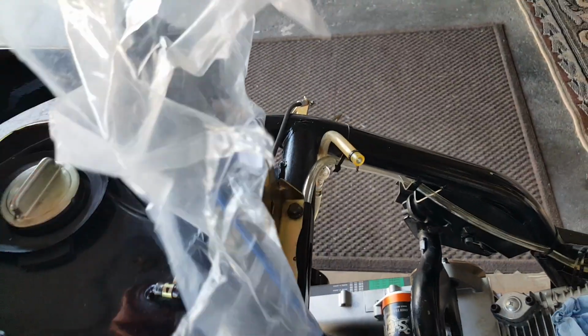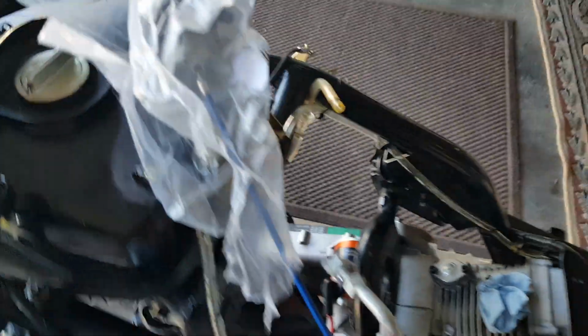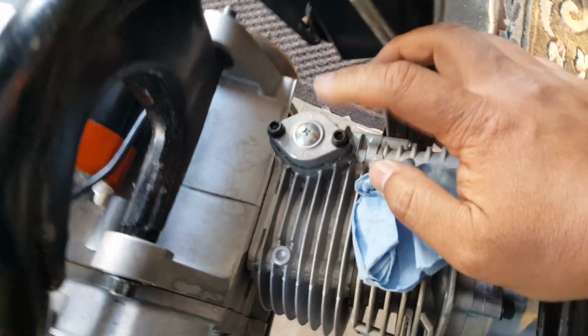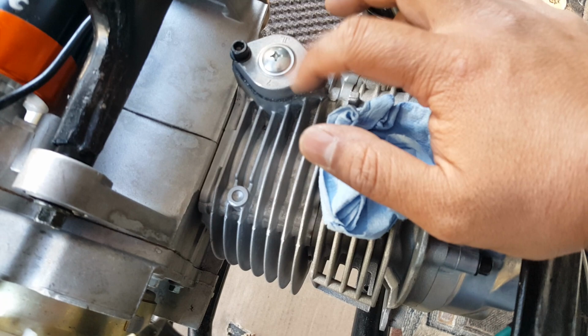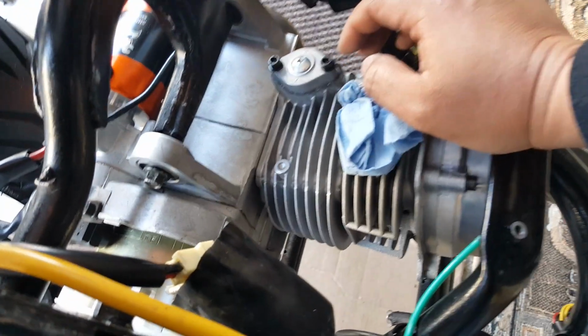All right, so we're gonna test our intake manifold, and then we're gonna see our height too, by the way, because we have to put our seat on as well. So we'll probably bring our seat out. We have to do a dry fit because we're planning to not actually put the gasket spray on there. One less scrubbing. I'm really happy for that. We put our original cam chain tensioner on there now. It's already blue Loctite, everything ready in there, including the Phillips as well. So that one's done. We can connect our wires now, I guess.